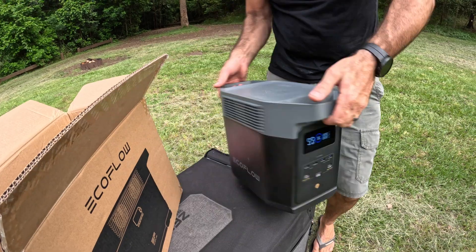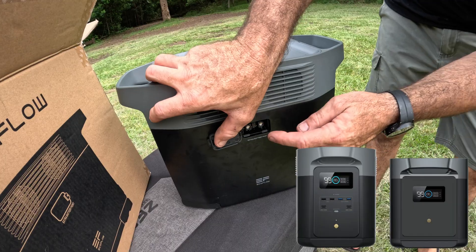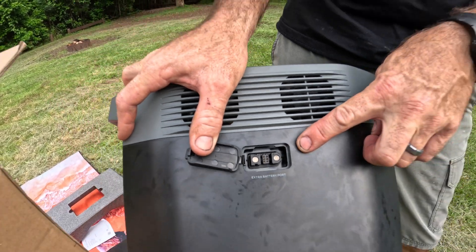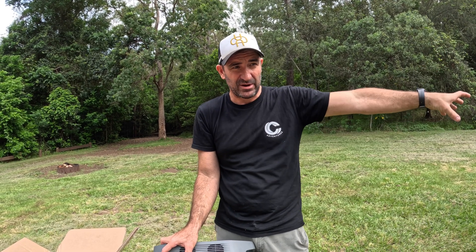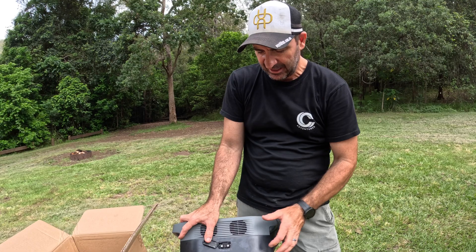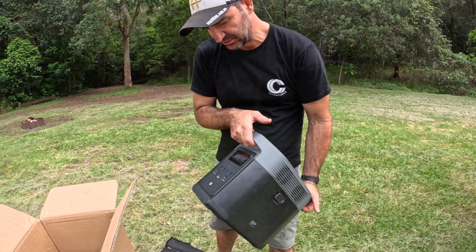This side here has a special feature - you can actually buy an extra battery and plug it in with the cord on the side. Or EcoFlow have the alternator charger, which we have in the car now. So while I'm driving, it sends charge through the alternator charger at 800 watts max through the cord that runs into here, charging this while we're driving. So if you've got a fridge running it won't drain the battery - you can charge it at the same time. That's a special feature for the Delta II.